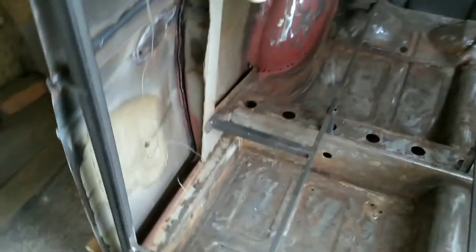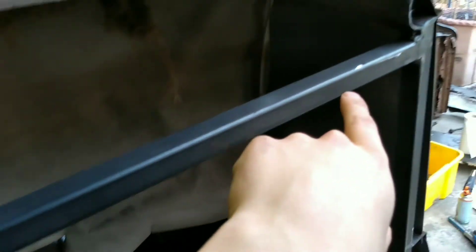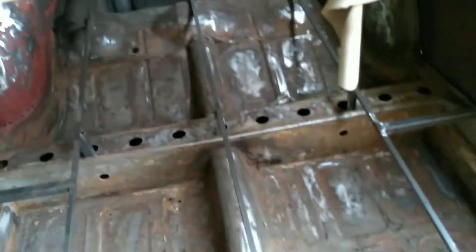You may be thinking, how's he going to do that? Because that's a big old heavy sheet of metal - it's only 1.6mm thick but it is hefty. What I'm going to do - I hope it'll take the weight - is lift it up a bit, then drill four, six, eight, maybe 43 self-tapping screws straight through the metal into these bits of box section. That'll hold it in place, then I'm going to draw around the edge on the outside, unscrew it, cut it out perfectly, screw it back on, weld it in, and it'll all be fine. Won't it?